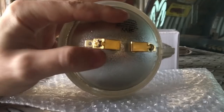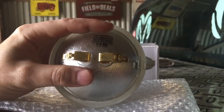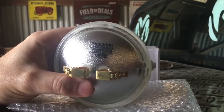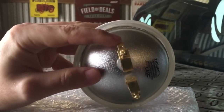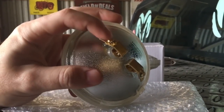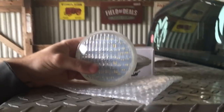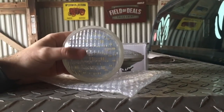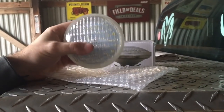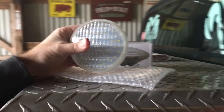These will still fit in the original housings for a Farmall Super C or the 560 — different applications. For $17 I wasn't afraid to pick them up. You'll notice it has little screws for the wires, so it will work with the wiring already there. You can use a spade connector or the screw style, which is what's on the 986 currently. These are flood pattern — you can also get spot or trapezoidal — but flood is the only configuration in this $17-$18 light.